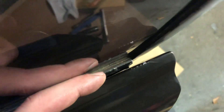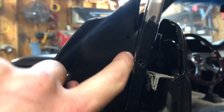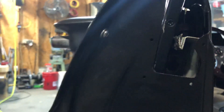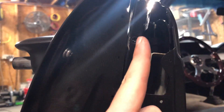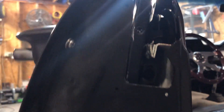The outer gap has the same issue as before — a whole bunch of space up front that tapers down to practically nothing, and that's where it tears the weather stripping in the back. For the belt line, the glass also sits damn near against this. There should be a weather stripping piece that centers the glass, not pushing it all the way over to one side.